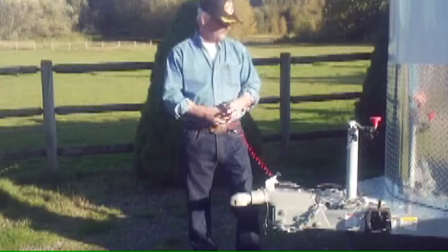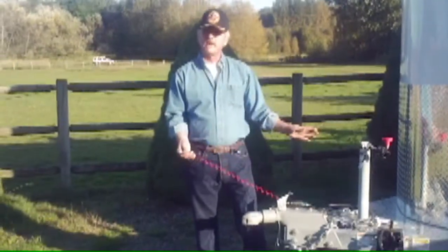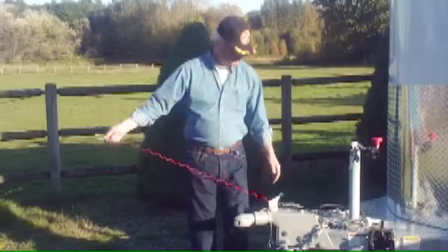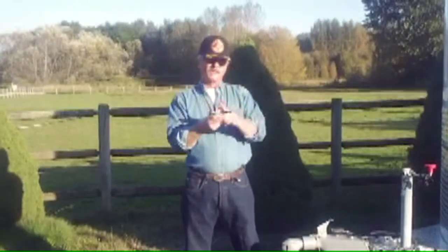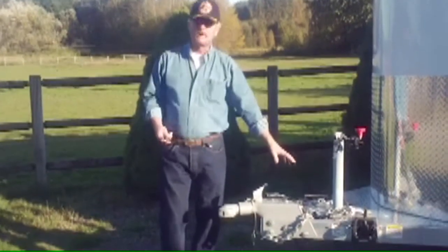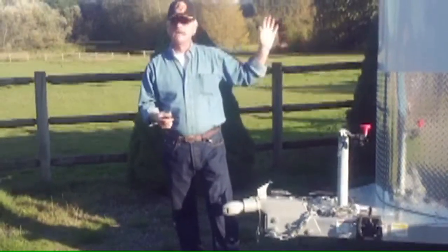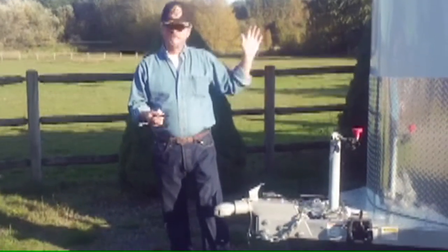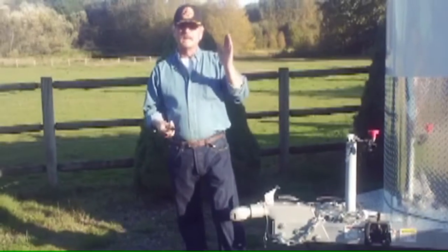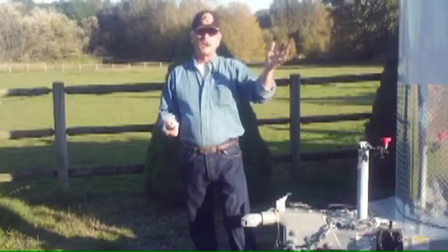It's important that this is maintained. For a few dollars you can get a charger that works off your auxiliary circuit on your tow vehicle that charges this in the event it was ever pulled. If everything else has failed, this cable is about 4 feet long — it allows everything else to fail, then deploys by pulling out and pulling the pin, which makes contact with the battery and the brake system. By doing that, it puts on full-on brakes — all the power of that small battery to the brake system — and stops the trailer from rolling or freewheeling back down the highway, whether you're on a hill or anywhere. It's important that your brakes are adjusted properly and evenly so that when the brakes ignite, the trailer tracks straight and true rather than going left or right into oncoming traffic or, God forbid, off a hill or a cliff.